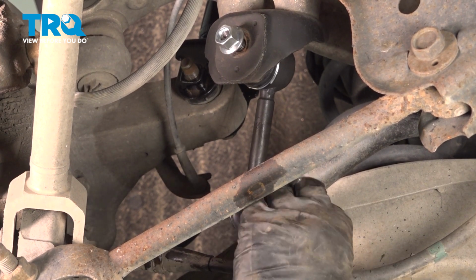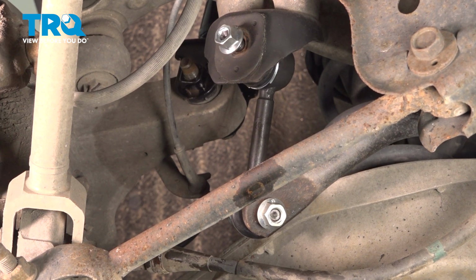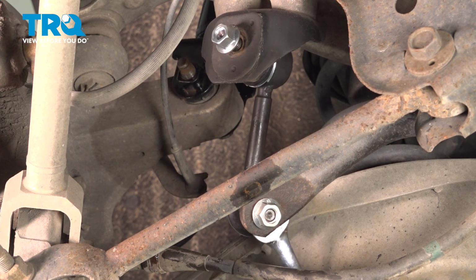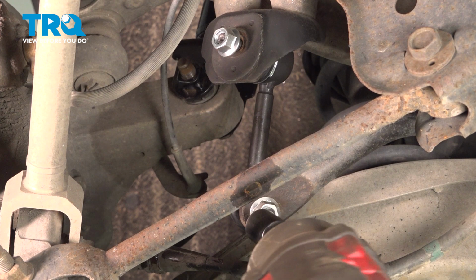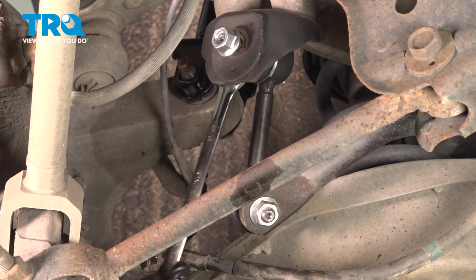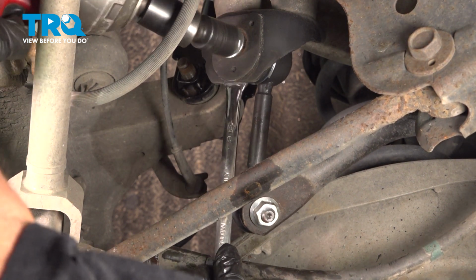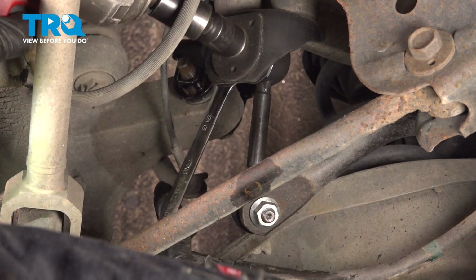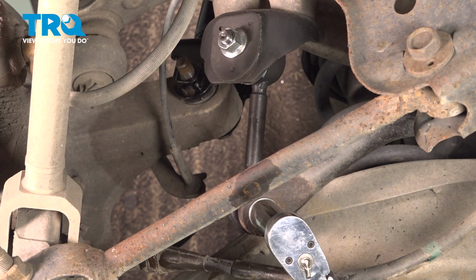The new lock nuts on this link are 15 millimeter, and there is a hex in the back that's a 14 millimeter that you can hold it from spinning. So I'm going to put my 14 millimeter on the back here. Hold that. Snug it up, and then I'll get my torque wrench and do the same to the top. Millimeter socket, torque wrench is set to 37 foot-pounds.